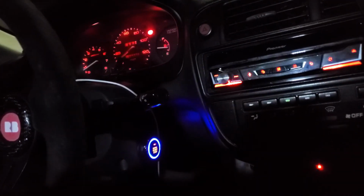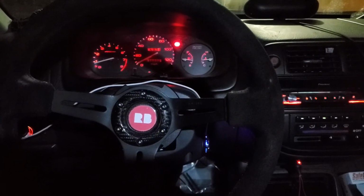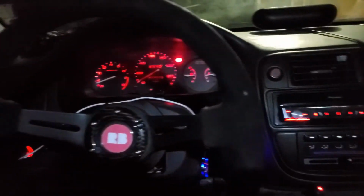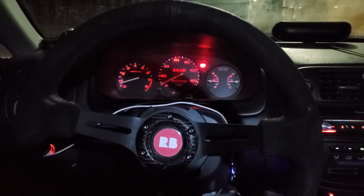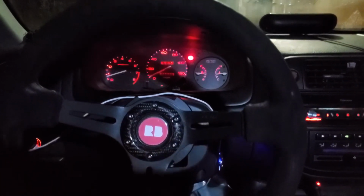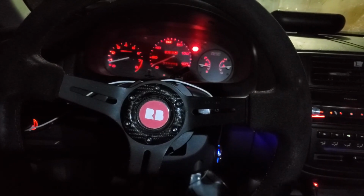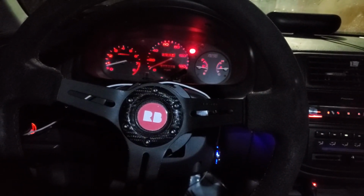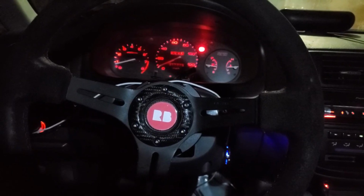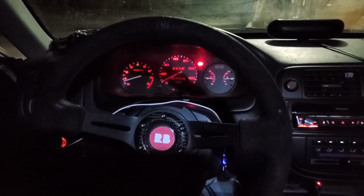So I would recommend this kit for people who have a Honda, especially as it's just another preventative anti-theft device. Overall, I'm happy with it. The install wasn't that bad. I had to cross-reference a couple times to other videos from other YouTubers, but like I said, the hardest parts were the two security bolts on top, and taking the plug out of the brake pedal and putting it in. When you pull it out, there's only one wire with a stripe on it, I believe, and then there's one green one. The green one's your constant 12 volts, so you tap into that one. Tapping it in is kind of a pain in the butt, so you have to use some pliers. But pretty much, it's worth it, guys.